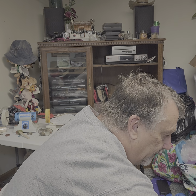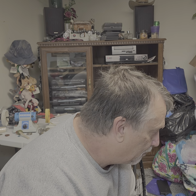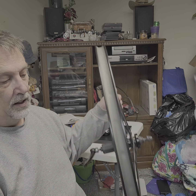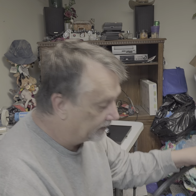We've got almost 300 miles on it. I don't mind that it's set up for a rim brake. That means that the sidewalls are stronger than this. I don't know how thick these are, but they're not very thick. If just one spoke had cracked, you could fix it. But literally every spoke on the wheel has a crack on it on the drive side. This is the drive side, and every one of them is broken.